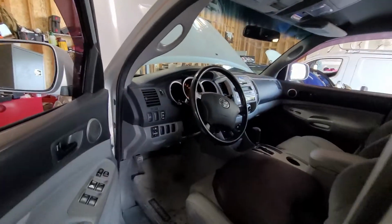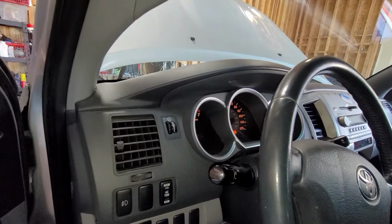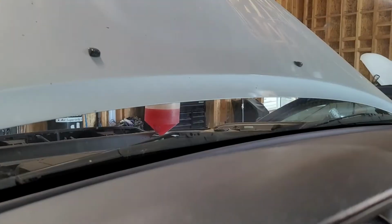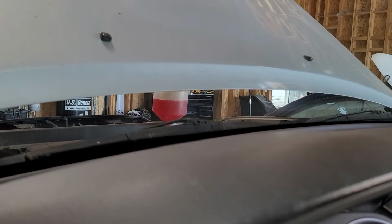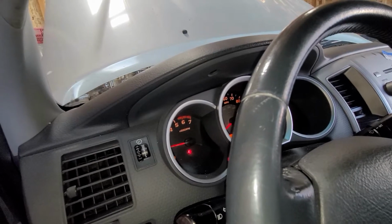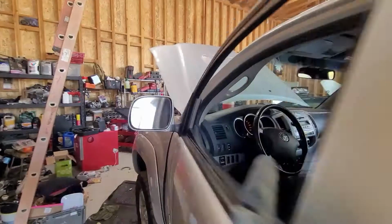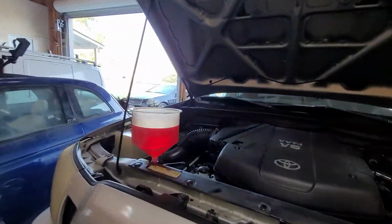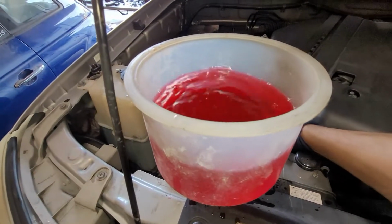And so we'll wait. You can give it a little gas here and there. I don't know if you can see over there. That'll get rid of any little air pockets in the system. So you can hold it up to like 2000 RPM and so forth, but I'm just gonna let it idle just like that. Keep an eye on your temperature. Squeeze your hoses just like that.